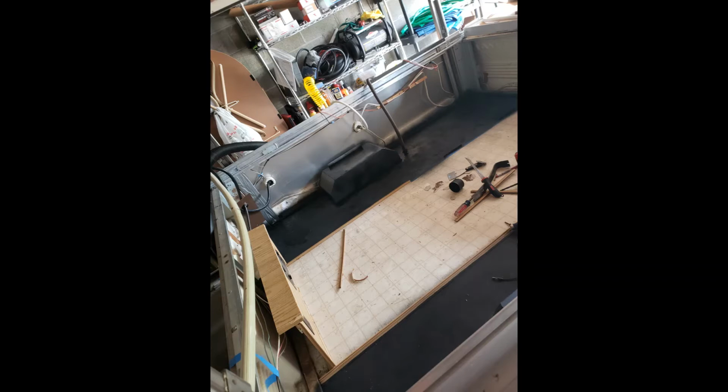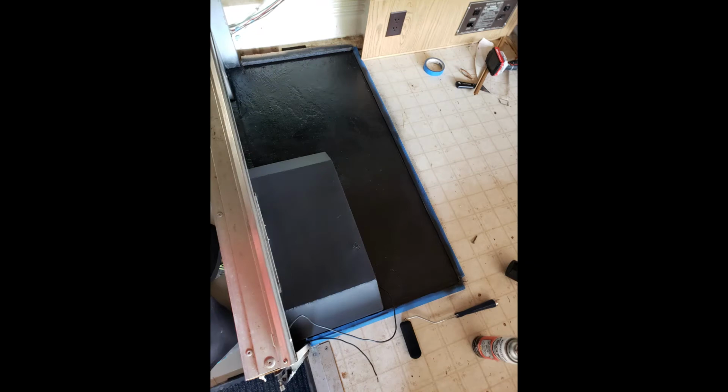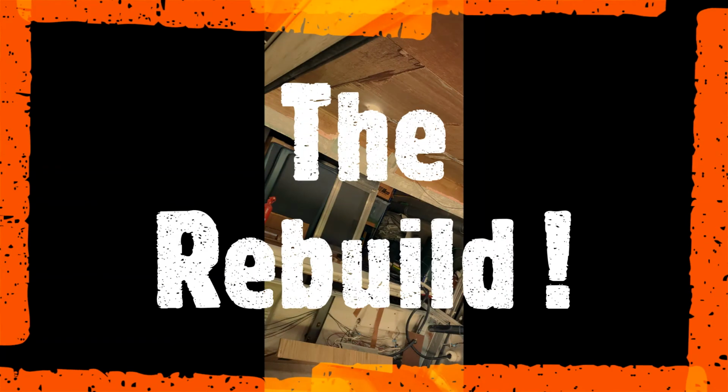One big thing I noticed was under the galley area, what has happened is they would keep pots and pans there. Those pots and pans would scratch the floor, moisture would get into the wood because the laminate was exposed, and hence using the truck bed liner as a second barrier to stop that and add a little bit of structure to it, and it works great.